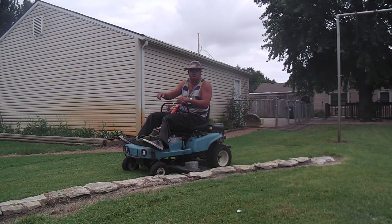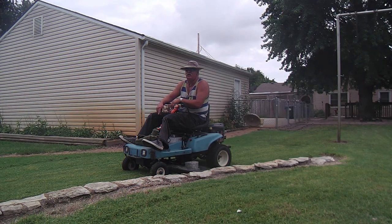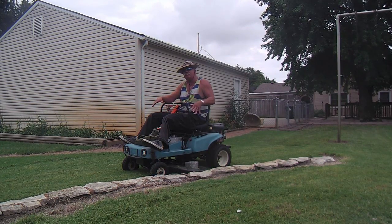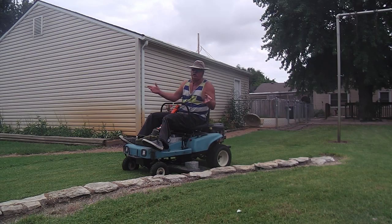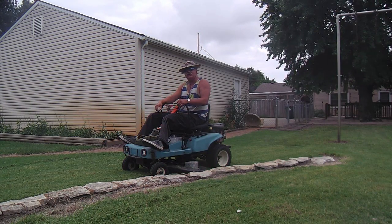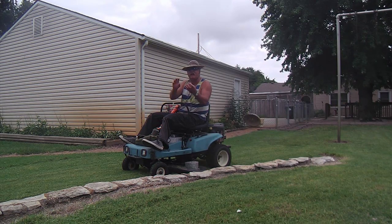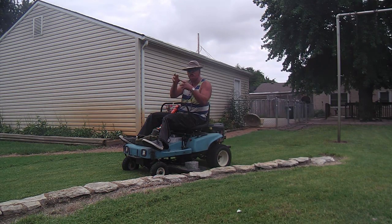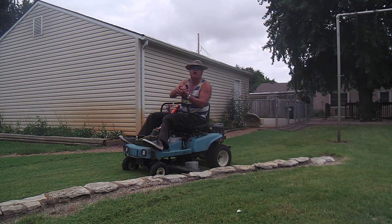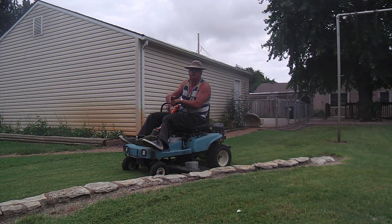There was a video recently posted. A guy went to a junkyard or a scrapyard, and he bought a Dixon mower that didn't work for $100. And it was the motor. The motor was the problem. So he took the head off. It was a flat head, no overhead valves. And sure enough, the valve seat had come out and was causing the motor not to run.